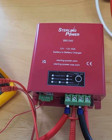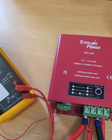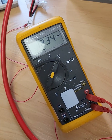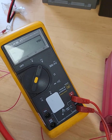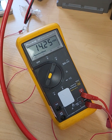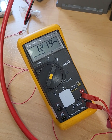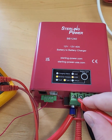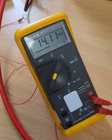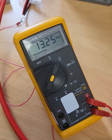Okay, so I've just taken the video off pause. That's just me turning off a load that I've got on the start battery. So what have we got at the start battery? 12.36V at the moment. Let's wait for this thing to kick back in — it should be fairly imminent. That's the leisure battery voltage; that's the start battery voltage. There we go, so it's just kicked in now. Reverse-charging LED is on. That's the leisure battery voltage, and then the starter battery voltage should push up to about 13.4V, and it ought to hold it there.